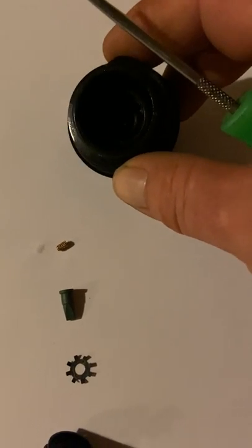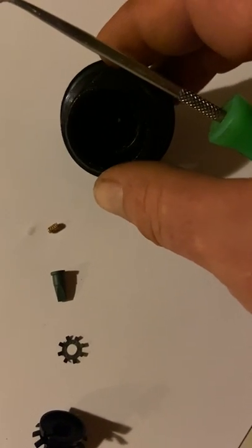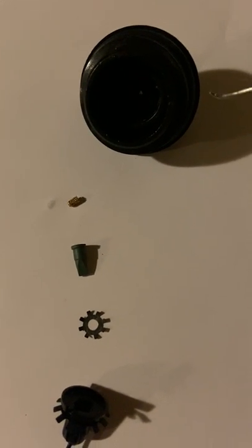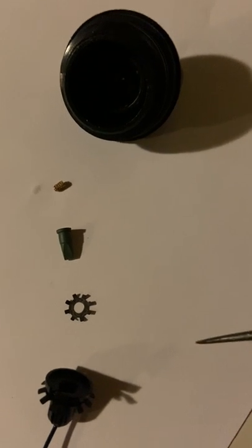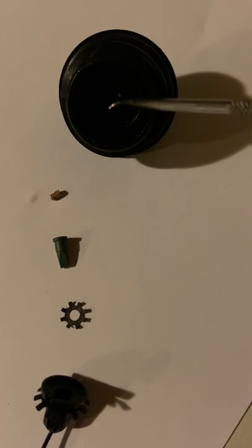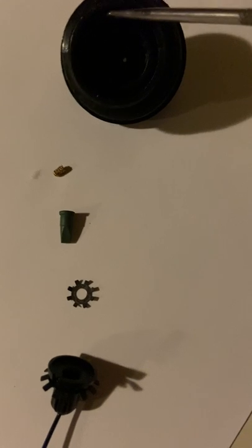Just to explain some of the issues I had — and I think this might be a lot of the problems that a lot of folks have with these particular units. You shut off the chainsaw and maybe five or ten minutes later try to restart it, can't start it, keep pulling on it, it won't go. Pull the cap off and gas shoots out. I thought, well, it's pressurized — I even read online some folks saying that's a pressurized tank — but I don't believe it is. I think it runs purely off a vacuum, and this duck bill is allowing vented air to come in and equalize the pressure in the tank. You're just getting an inrush of air and an outshoot of gasoline or whatever fuel mix.